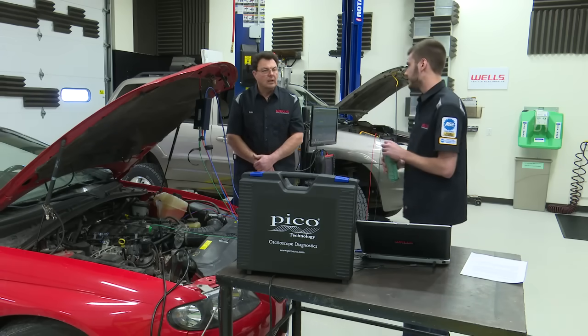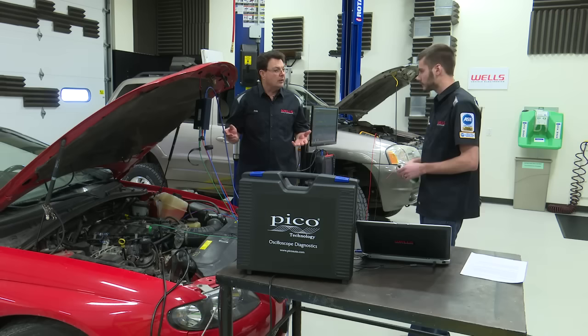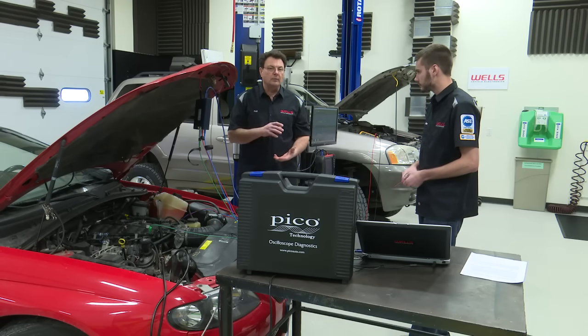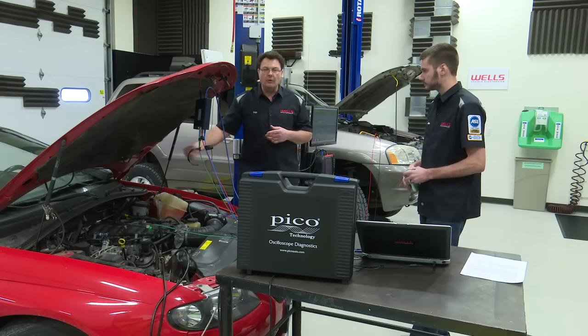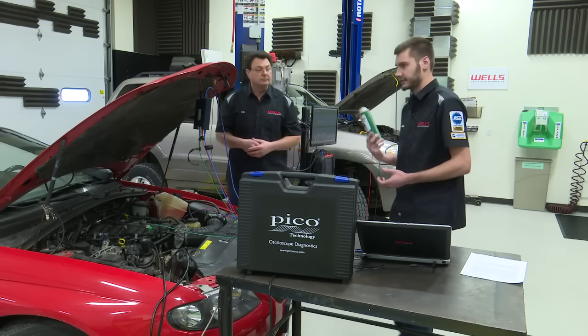What's the trick that you had, Fritz? Well, sometimes the injectors make so much noise if you got an arcing going on. Sure. If you believe you got an arc, get a little bottle of water with some salt in it, a sprayer, shake it real good, and spray it over. That'll make that spark jump. And if you do, do not spray anything. Yeah, exactly. Don't put any fuel in there.